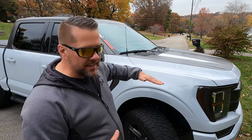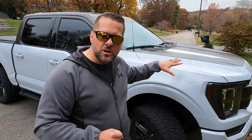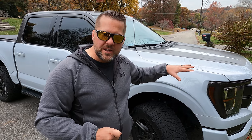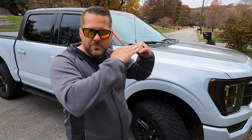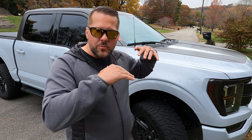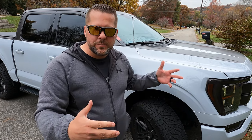If you do any towing, you know that if you load the rear end down and let the front lift up, you've got less control on your brakes because the front end doesn't have as much weight on it. So when you put Roadmasters on the back and add weight, you actually keep the front down and have more braking power, more stopping power, and you're not putting your truck in a bind. These are installed on both sides, so as you go around a curve this thing actually reduces body roll. We were riding in a stock truck just the other day with none of these upgrades and it had a whole lot more body roll than after putting Roadmaster Active Suspension on.